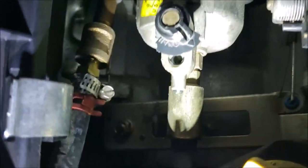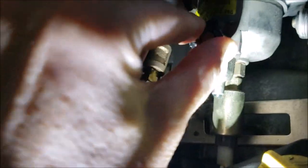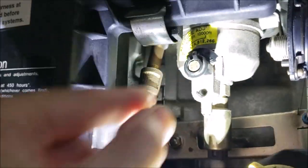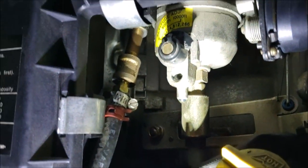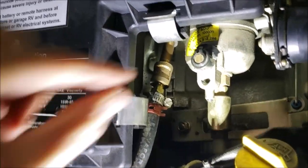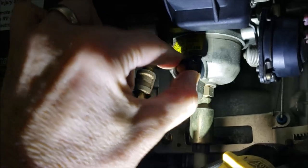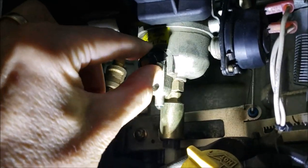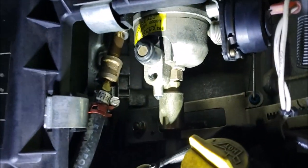Now I don't think you can do that without pulling the screw out first — you have to pull that screw out to do this. So back here, that's the factory position. If you had a surging issue and you can't get it to stop surging, with those curved needle nose pliers you can just snap those two little ears off and give it one full turn — that should be enough to richen your mixture. That's pretty much what I did to fix the surging on that 2002 Onan. I'll try to start this up and give a demonstration of it.